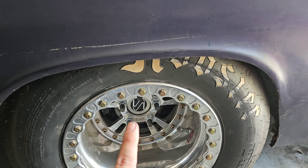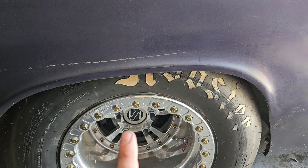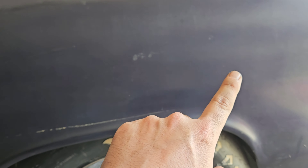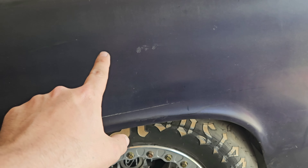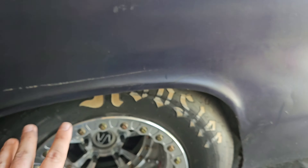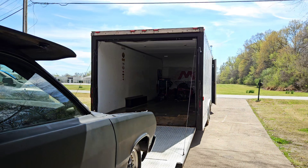I'm going to make a few rear end adjustments. I think the rear end needs to go over on the locator bar probably one turn, and then we need to lengthen the driver side bar probably two turns. Then we're going to load it back up in the box, hit the track, and see what it does. With that being said, I'll catch you at the track.